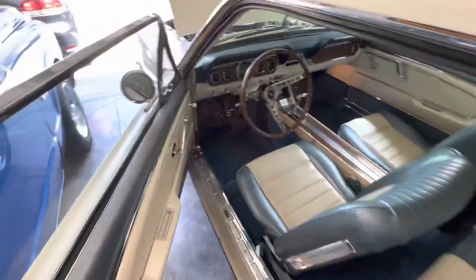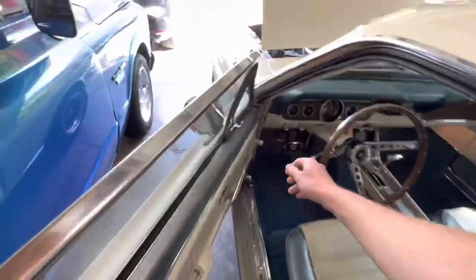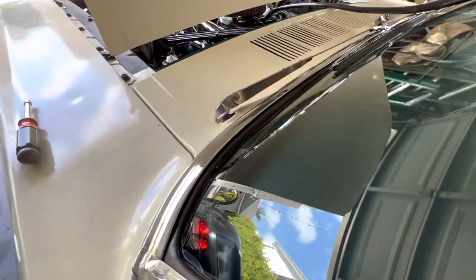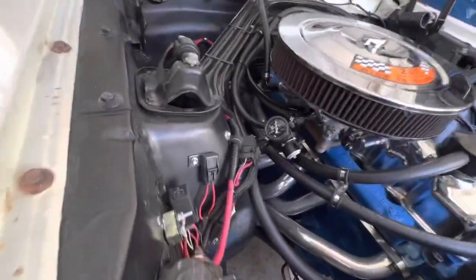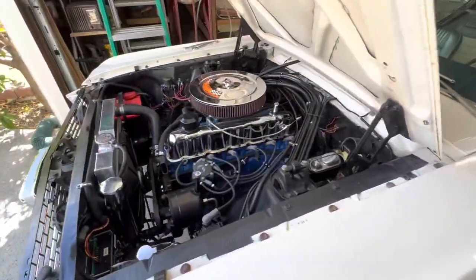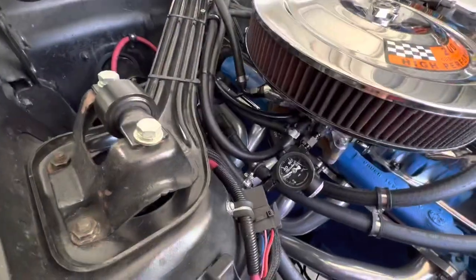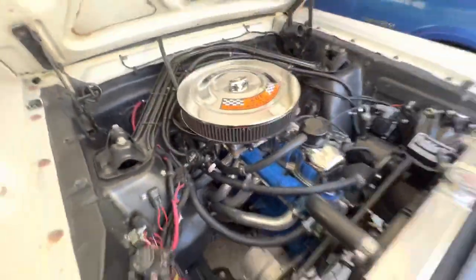We'll turn the key on here, and I'm going to try and do this real quick so I can see it while it's still priming. We'll just roll the window down. Kind of got to turn the key on and run over there and see what the fuel pressure is. 60 on the money. Let's give it a shot here. I did get fuel all over stuff when I opened it up — it's probably dried out by now, so let's give it a try.